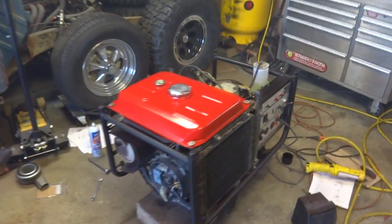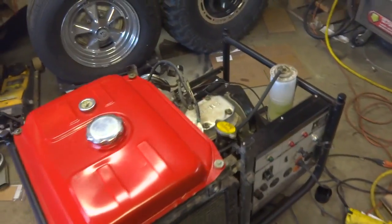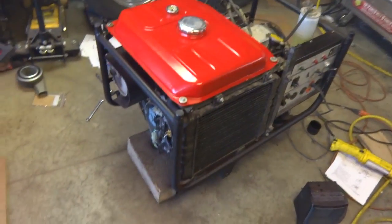I need to let that vent out and then we'll change the oil and the spark plugs, and we'll fire it back up and see how smoky it is. After that, we'll do compression tests. I'm going to drain the oil.